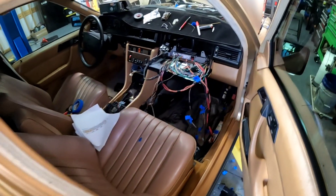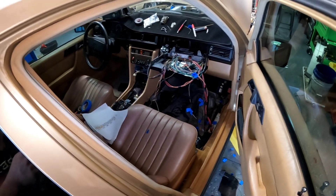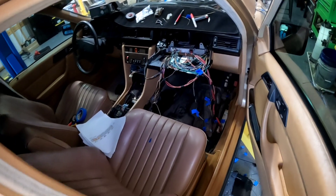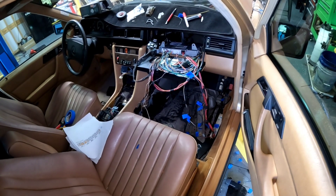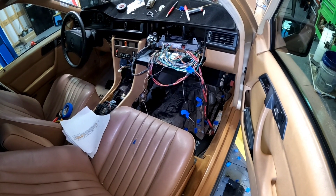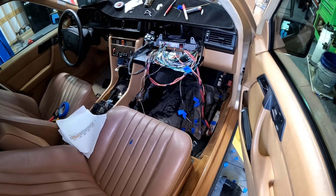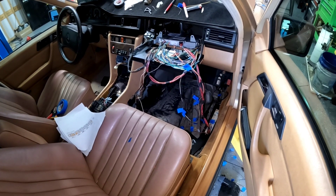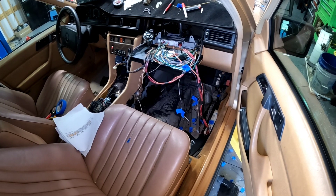Some things I've done in this harness are a little different. I'm not going to connect the oil switch to the low level sensor — nobody really knows if that's in the algorithm for the ECU. I don't think it is, so I'm going to leave it out. Hopefully it starts just fine. I have the low oil level sensor switch laying around, so if it doesn't work I can just plug that in and bypass it.